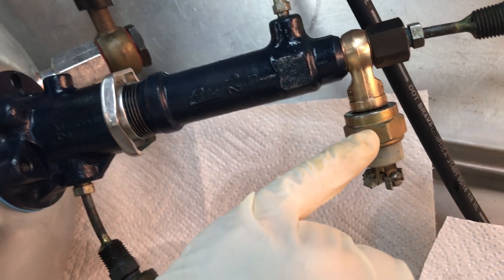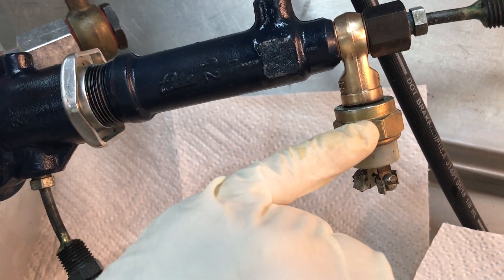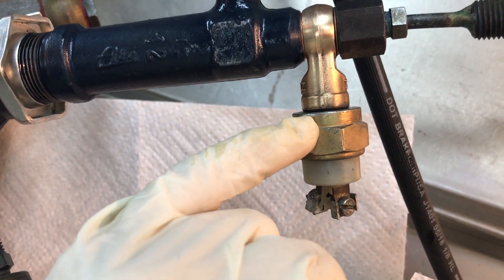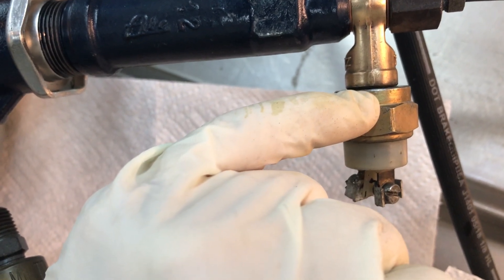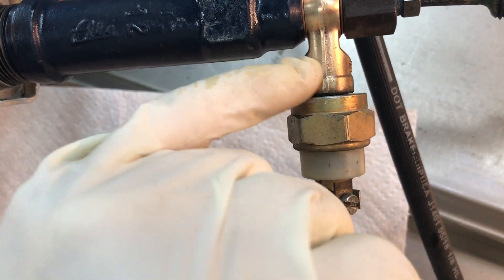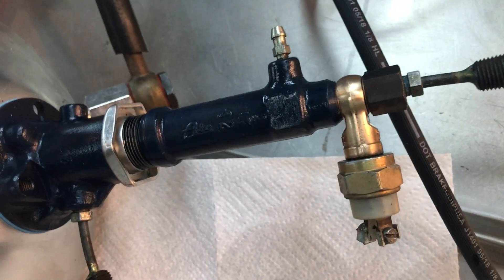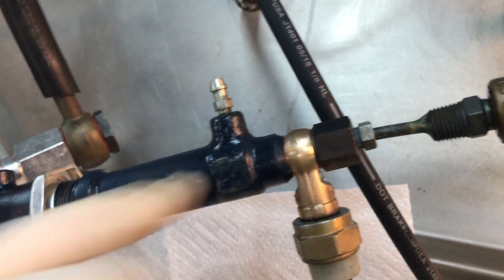Got you a good booster. Now one thing I want to note is these are 10x1 threads in here, and we've got 10x1 tapered threads on the brake light switch. Somebody screwed this thing in way too far — it's just supposed to be screwed in until the taper seals up. In the future this may be splayed out internally, so if this brake light switch ever goes belly up, you may have to screw it in just as far as this one. I've seen some of them using a copper washer underneath, or else just buy another brass fitting. I didn't touch this fitting because it's too rare and I didn't want to take a chance of it getting lost in the plater.